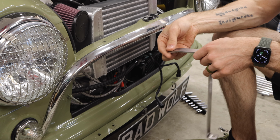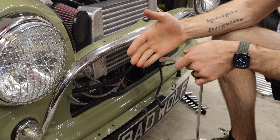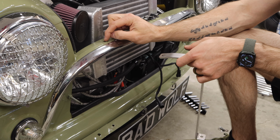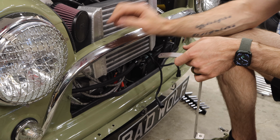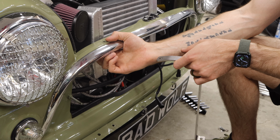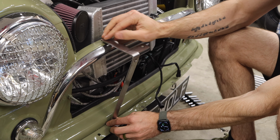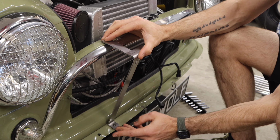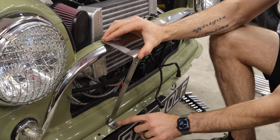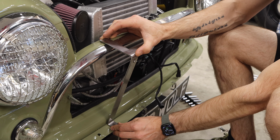Now this kit is going to take over that hole, and in my case, and what I would recommend you guys do, is use a small riv nut hole here. This is going to allow you to have a captive thread built right into this upper valance, and then that is going to mount your new bracket right here, and then we'll drill a hole. In my case, I've already got a hole down here on the front, which will allow the stabilization at the bottom of this bracket.